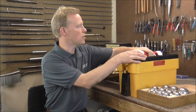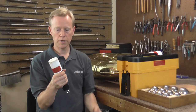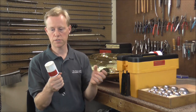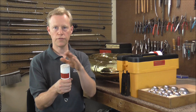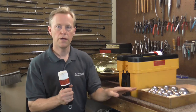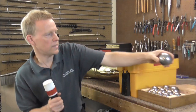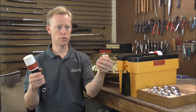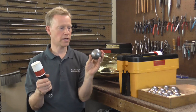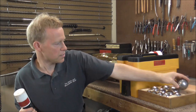These magnets are very strong, and you have to be very careful whenever you are holding one of these magnets, because things that get too close can go snapping to it very quickly, and if your hand is in the way, it can cause damage. So actually, I probably shouldn't even have my hand right there. There are several different sizes of these dent balls. They are very large, and you notice I am not putting them too close together. The larger the dent ball, the more pull it has towards the magnet.